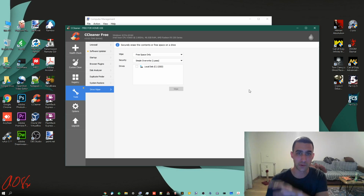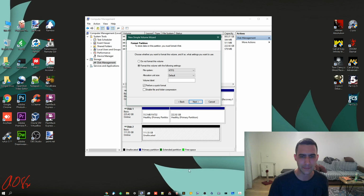And what that will do is it will write zeros to every block. And then it will write zeros again and again if you tell it to do more than one pass. Doing that takes away any possible trace, because sometimes even when you do a single pass overwrite, some of that data is still there. It's still sort of hanging on.